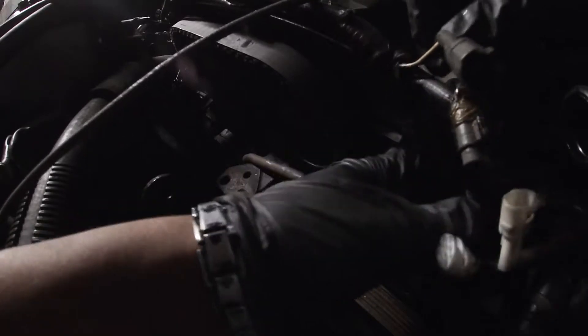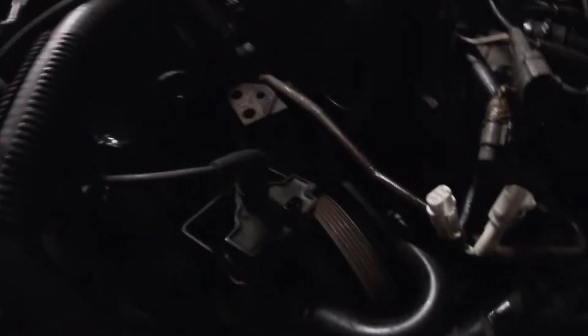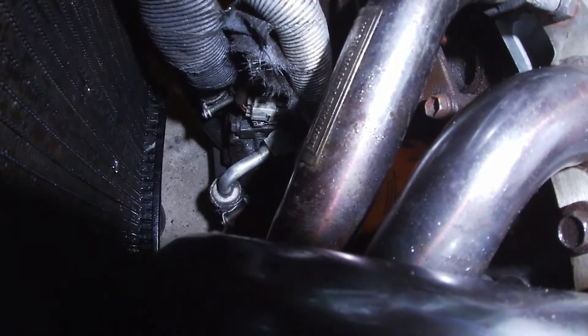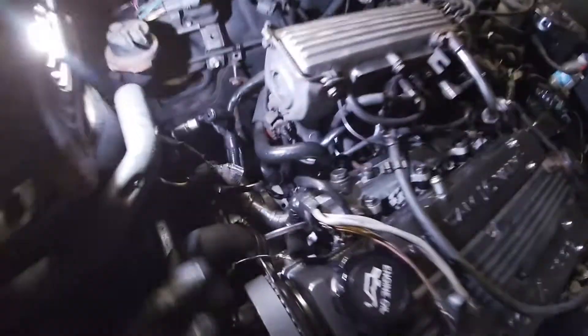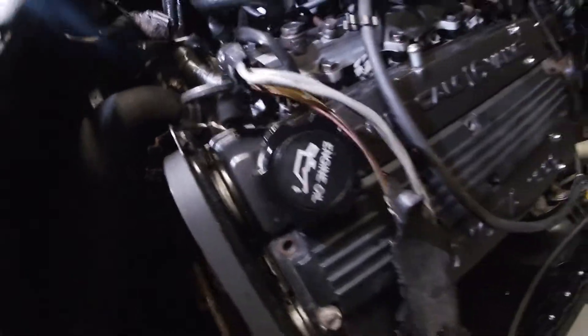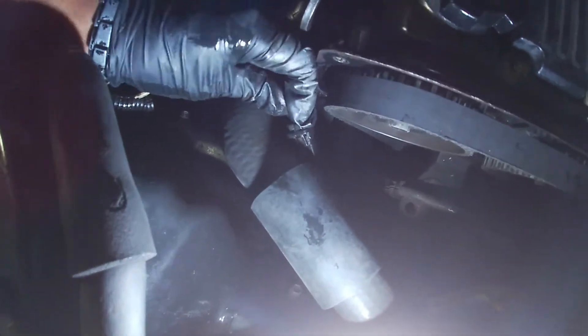We're gonna go ahead and follow down. There's one connector down there — you basically push the clip down and then pull it. We got these connectors right here so we'll move to the side. We'll lift this electrical harness up so we have more room, and just disconnect this ground right here. Now we already got a lot of these electrical connections disconnected.